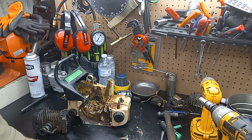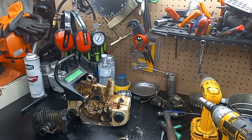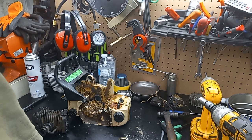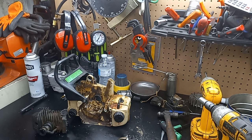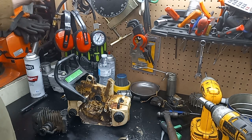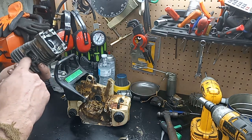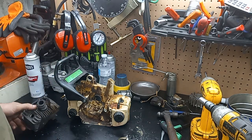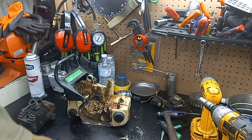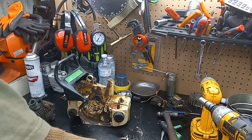If you guys are locking your cylinders up, don't use these. God forbid, don't use these. You throw that through your plug hole and start reefing on it, you're going to poke a hole right through your piston — I've seen it done time and time again. Just fill your cylinder with starter rope. All you got to do is make sure the piston's up far enough where you can't get anything down the exhaust port, pack it full. Works like a charm. It's safe. It spreads the load out over the whole piston. Just a much better way to go.